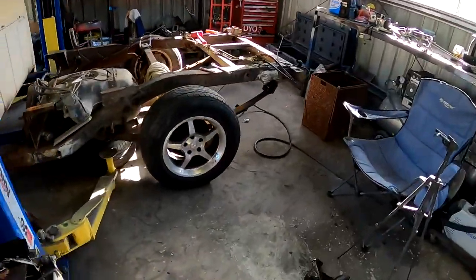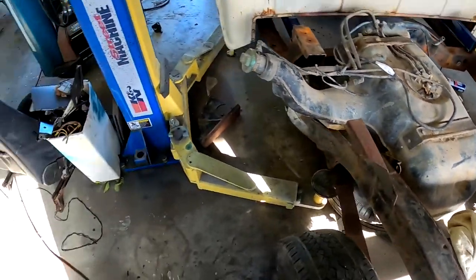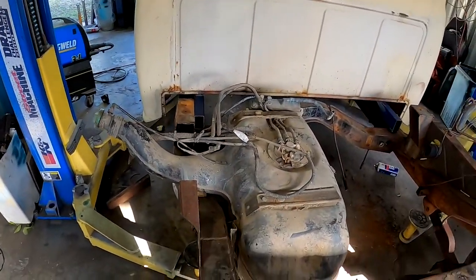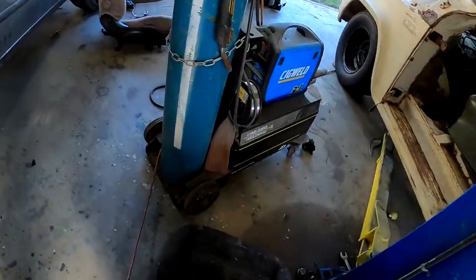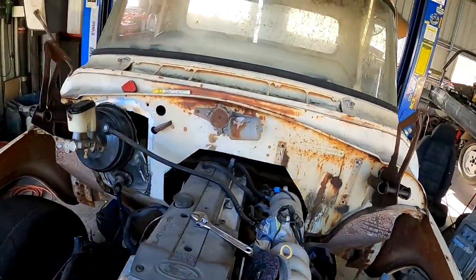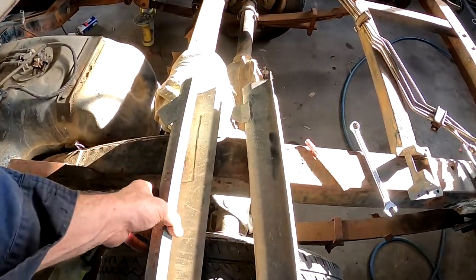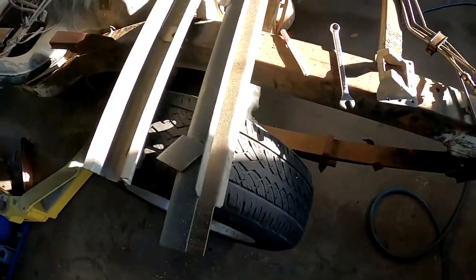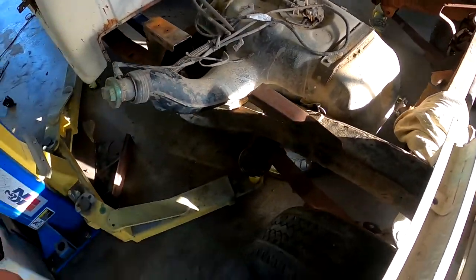It's Monday - just knocked off and taped up. Where we got to on Saturday was starting to trial fit the fuel tank. I'm going to keep going with that and remove the remaining brackets out of the Falcon, because I want to retain all the factory mounting setup from the Falcon carried over to the Inter. These brackets sit on top of the tank and that's the front bracket where the strap hooks in. I'll pull the tank back out, assemble it with the straps, tighten it up, then sit it back in the chassis and see how I can attach it.